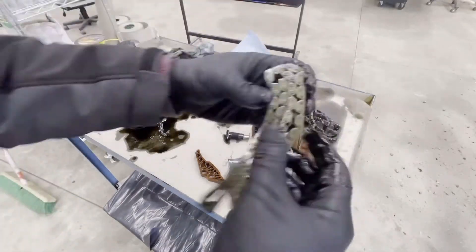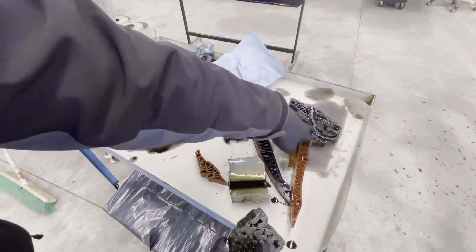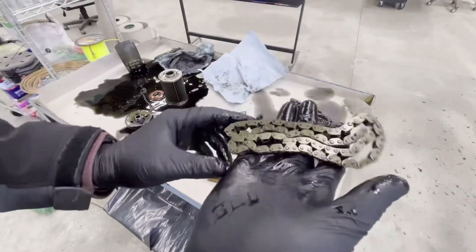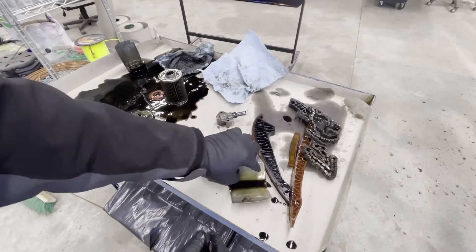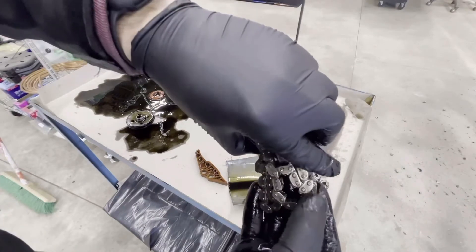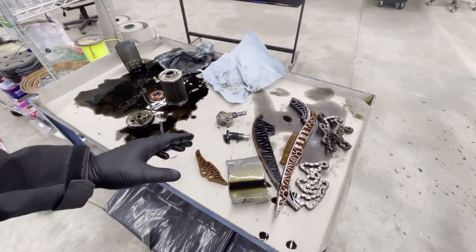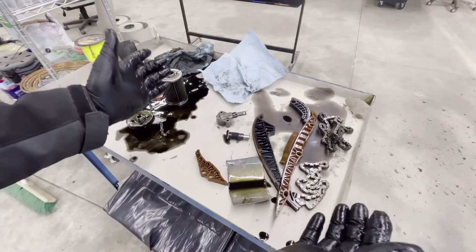Every single chain link is damaged a little bit. The other chain - the main timing chain for the valves - looked almost the same length and appears okay aside from being stretched just a bit. My oil filter was full of metal particles, so I changed the filter and I'll run the engine again and change it once more to clear out any remaining particles - both aluminum and steel - so they don't get into the crankshaft and score the bearings or sleeves.